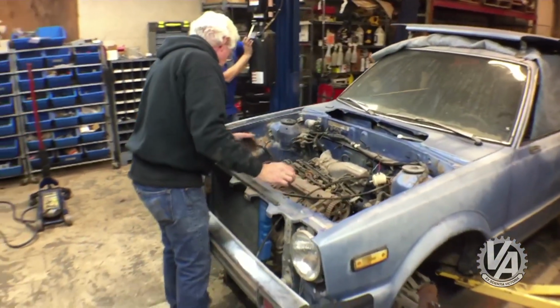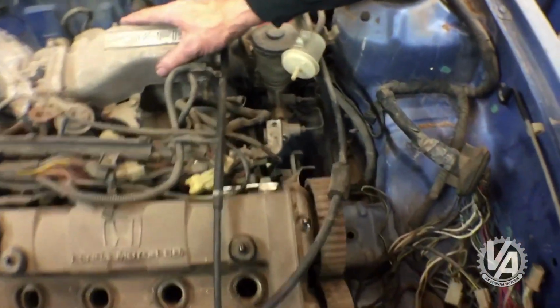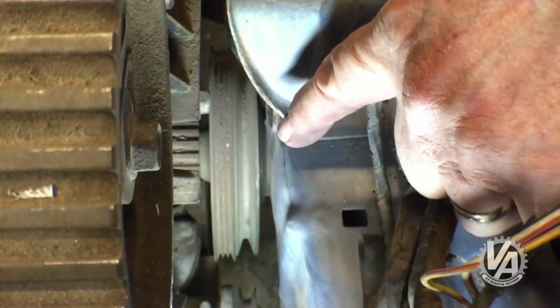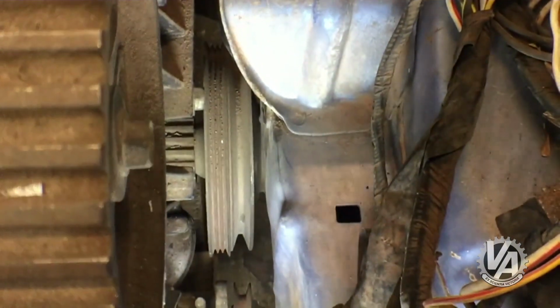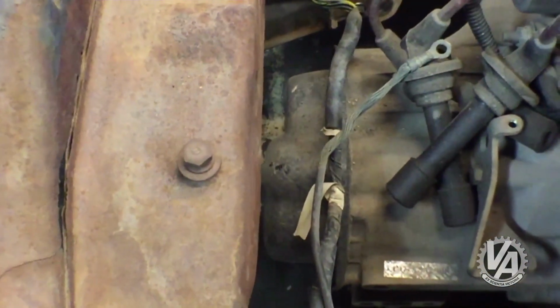First up was the 87 Integra motor. It was probably the only one that's going to fit without a whole lot of modifications to the engine bay. We noticed that it has a couple of accessory pulleys on the engine that were interfering with the frame rail. If we lowered the motor low enough where we thought it belonged, there was a power steering pulley and an air conditioning compressor pulley that were underneath the frame rail or on the side.